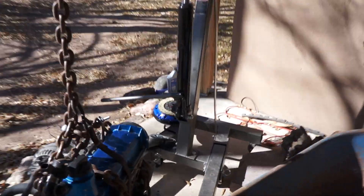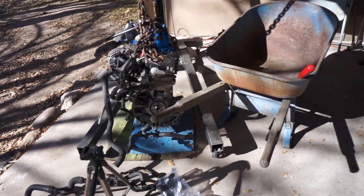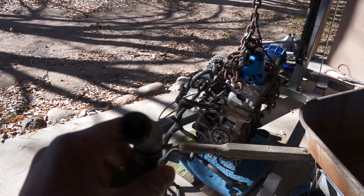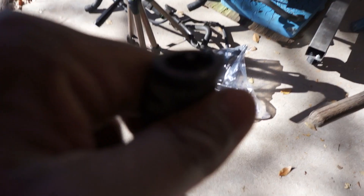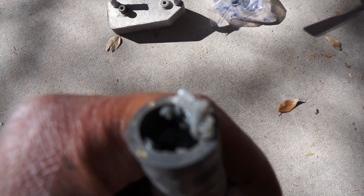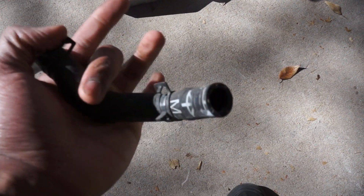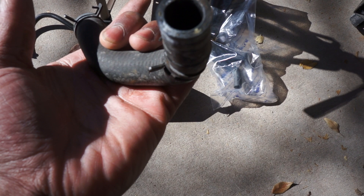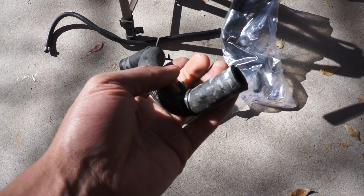Here's the engine, and I've got the clutch sitting over there. I'm about ready to start throwing the flywheel and stuff on. But I did pull the lines off of the automatic transmission cooler — you can kind of see inside the line — that end is totally plugged. I used some head gasket repair stuff, and that is definitely what I poured in there. That stuff that's coming out just plugged this whole thing. This hose does not flow anything. That is probably why my transmission overheated and broke. These hoses are totally ruined — the whole hose is just caked with it.